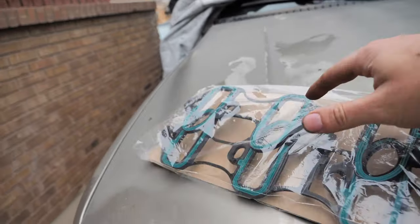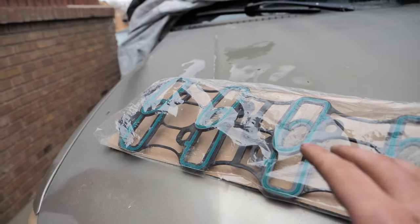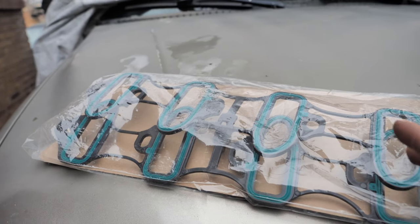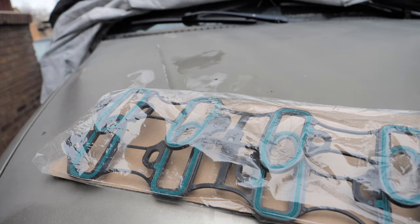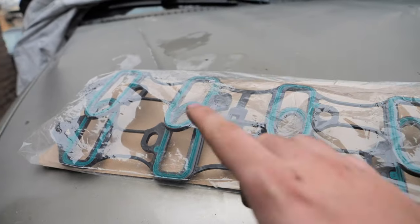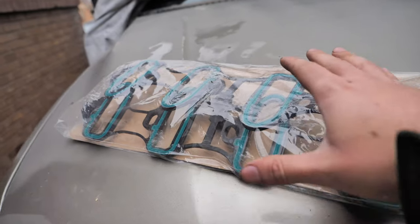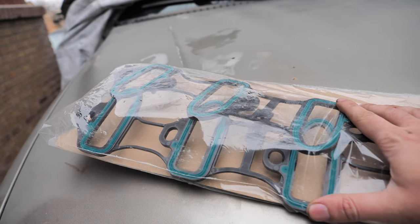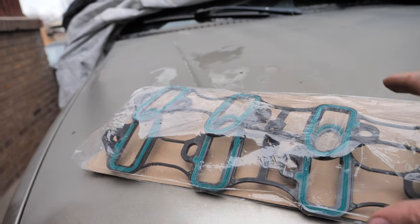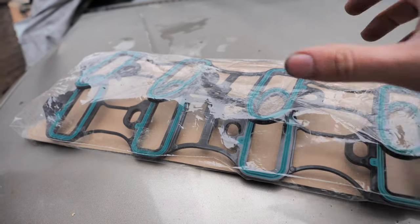These often go out, and you often get a check engine light for an oxygen sensor being out. I did a previous video on replacing the oxygen sensors, and because I disconnected the battery and plugged it back in, everything seemed to be working just fine. But then the check engine light popped up, along with some EVAP codes — so chances are, if that happens to you, it's time to replace the intake manifold gaskets. This is actually a very simple job. It's just pretty tedious with all the stuff you have to do, but it's really not that hard. The only specialty tool I had to get was a torque wrench that measures inch-pounds. Everything else should be pretty common. But without further ado, let's get down to it.